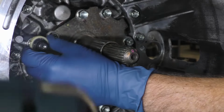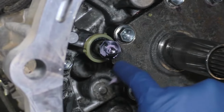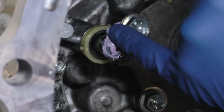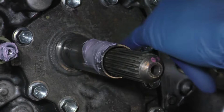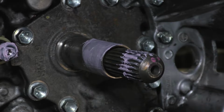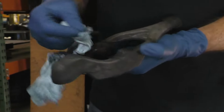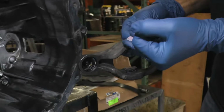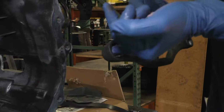Make sure the plastic retainer to secure the clutch release fork is in position, and then place a small amount of lube onto the pivot ball. Place a small amount of lube on the guide tube and input shaft. Clean any grease, dirt, or grime from the release fork. Place a small amount of lube into the release fork pockets and where the release bearing makes contact.